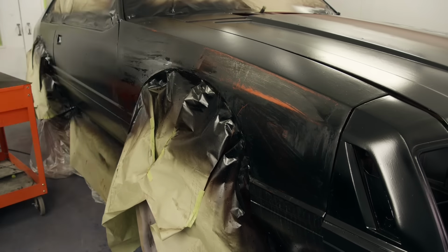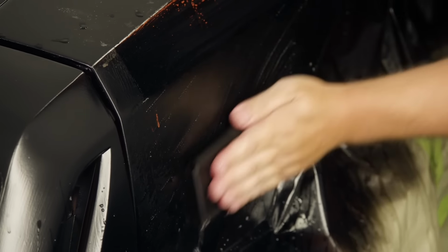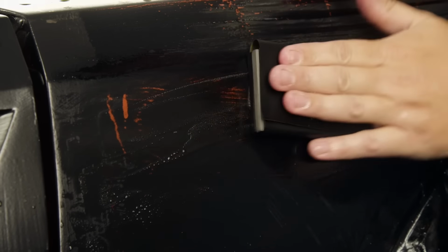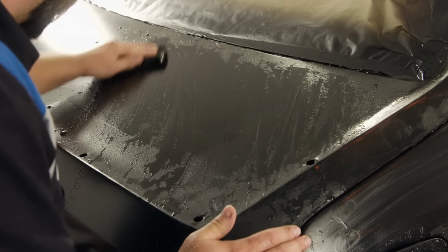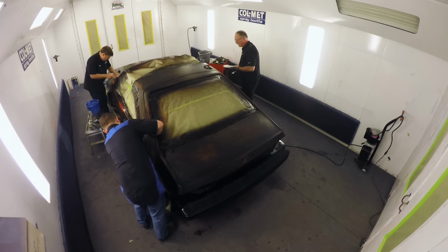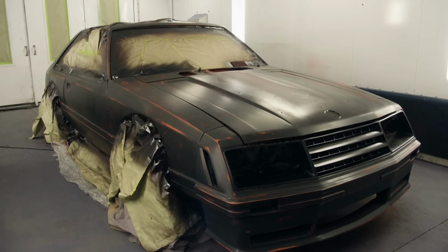We're going to be sanding with 320 grit paper, making sure that the surface and paper are wet. When sanding, you will want to put medium to heavy pressure on the car's surface, sanding down until the red oxide starts peeking through. You will want to make sure to sand in multiple directions to help with the distressing. A little elbow grease, and man, we made this thing look like she has been sitting in the old junkyard for 20 years.